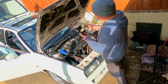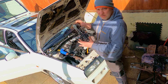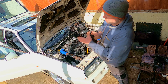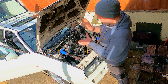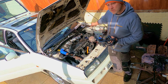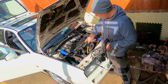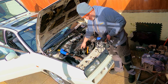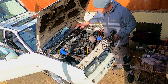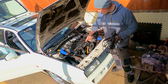I've started modifying it by the old Corrado bracket — I've actually welded parts of the plates. Luckily I have a donor set which I've been able to mess around with. All I've got to do is tidy up these pipes, tuck them behind there, and just have three pipes running through. I like everything factory, so I'm going to keep the vacuum ball — it adds a little bit of extra vacuum into the system beyond what's in the servo lines.